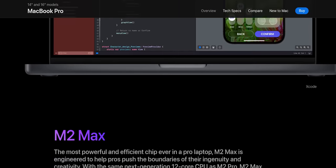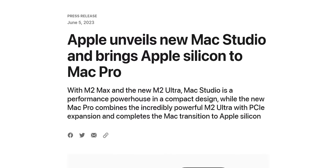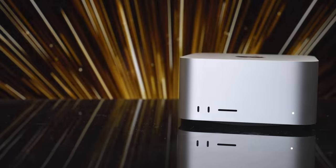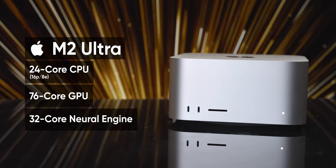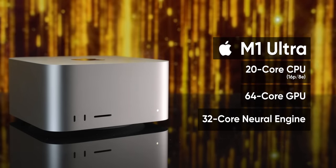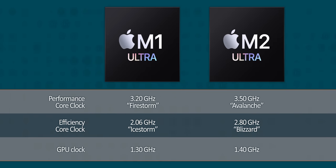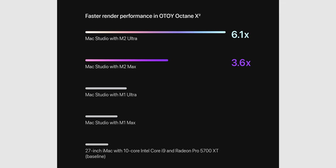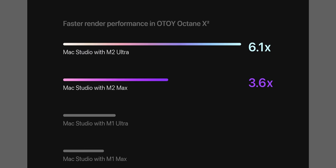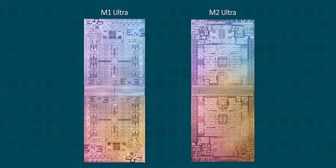Since it's the same Wi-Fi 6E module found in M2 MacBooks, that makes for a maximum transfer rate that is double that of last gen, should your wireless router support it. The stars of the show, however, are the upgraded M2-based SoCs. M2 Max is the same SoC found on the MacBook Pro 14 and 16, while M2 Ultra is only available on the desktop Mac Studio and the Mac Pro. It's the most powerful silicon Apple can build — ours is the most powerful version, with 24 CPU cores and 76 GPU cores — not a massive improvement on paper next to our M1 Ultra Studio, especially since the memory bandwidth and UltraFusion fabric connecting the two dies is the same as last gen. But with the extra cores also comes higher clock speeds for both the CPU and the GPU, which according to Apple gives the M2 Ultra over double the 3D rendering performance compared to last gen, achieved in large part by the move to TSMC's enhanced N5P manufacturing process.